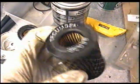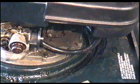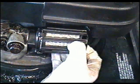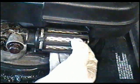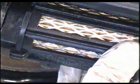The old air filter that was in there is part number 35066. And I'm going to put a new one in. To put the filter in, just put it over here. It's going to kind of clamp in there. Make sure the filter's pushed in right against the backing plate. Then you want to line up this little clip here on the housing over here. There's a groove here. And then just push it in. Then push it in and turn it clockwise, and it's going to lock it in there.